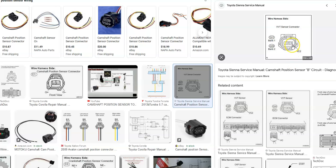If you're not getting any reference voltage to one of those outer pins when the key is in the on position, very likely there's a blown fuse. There could also be an open in the wire, but a blown fuse is a common problem. It's usually located inside the engine compartment, labeled something like EM2 or SNS — Google it for your particular Toyota. It could be under the dash, but it's usually in the engine compartment.